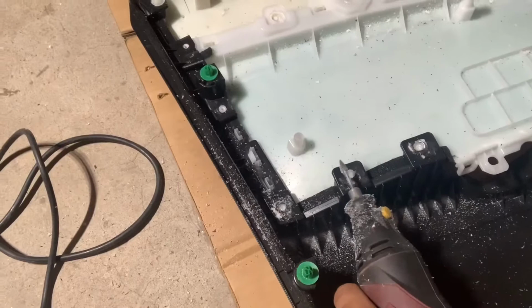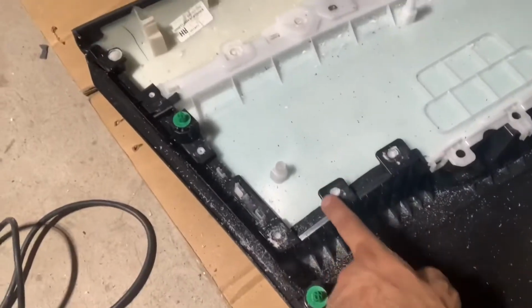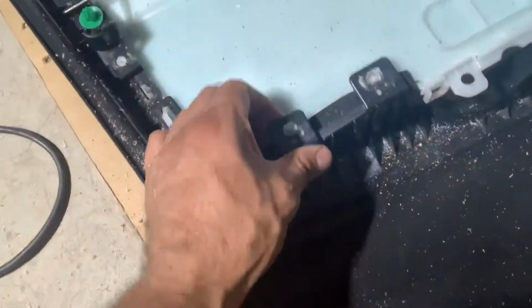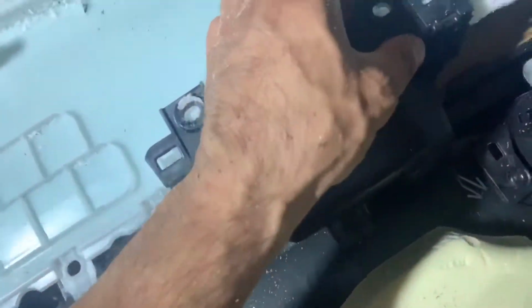around the whole plastic weld. So you don't want to dig in, you actually want to kind of grind down the surface. That way you can just pop it like that. So once you feel you've got enough, put pressure on it, kind of separate them. So as you can see, they're pretty much separated.